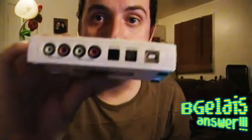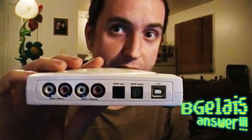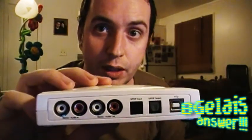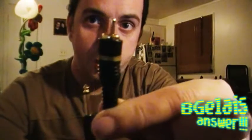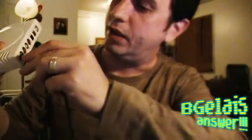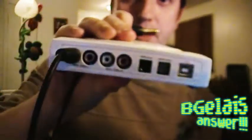This box is an input-output USB audio codec. It's detected by Windows. You don't have any driver to install, you keep the default driver. With that, I use a special wire, with a one quarter plug for your guitar, and the jack finished with an RCA male cable. I plug this part into the guitar and the other part into one of the two channels. Prefer the stereo input of the box, and put this on the first one or both.